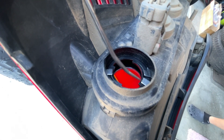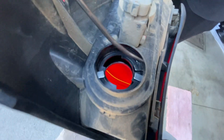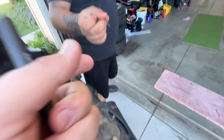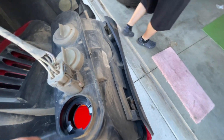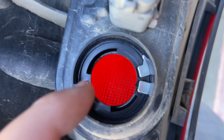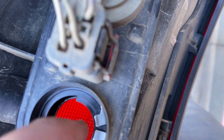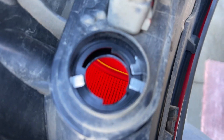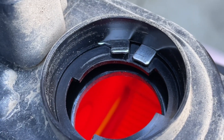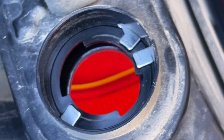I'm using a pick at the edge to lift the tab up and bend it enough to get something underneath. The bulb should push these back down to where they should be. We have a zip tie here — stick a little piece underneath so it doesn't push back down again. You can see I have a little piece of zip tie underneath. Push it in just a bit more, then press the tab down. See how it's lifted a little? That's what you want — it makes contact with the bulb holder.